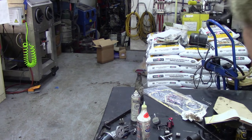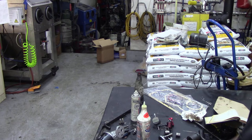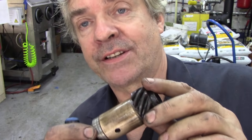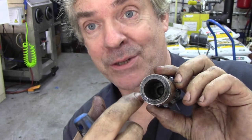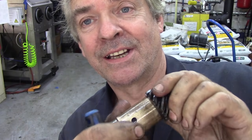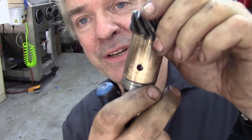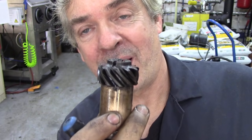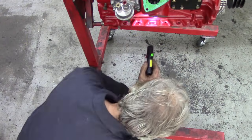If you did it before using the P on the pulley, you'll get thrown out all over the place — it doesn't work; it has to work on the firing stroke. It puzzled me, but I haven't done one of these for a long time — it must be 15 years. Now, the worst part about this is it's easier to put this in if you haven't got the oil pump driving. If you've got the oil pump driving, not only have you got to line the spline up for that, but you've got to line up the helical gears to mesh with the camshaft, and also line up the hole here for the bush because naturally this turns — when you drop this down, it's going to turn. It does not go straight and parallel.